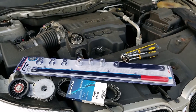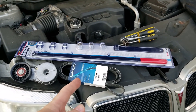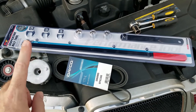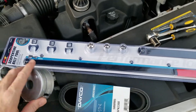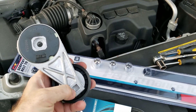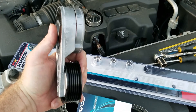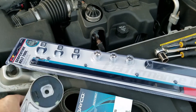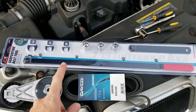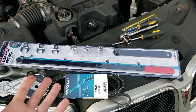So let's get at this here. The first things you're going to need are your belt tensioner and a good quality belt. On this one specifically, you're really going to want to invest in one of these specialty tools — it's going to make your life a hell of a lot easier because there's zero room to try and get the tensioner off. It sits so close to the body of the car that you can't get a regular three-eighths inch ratchet in there, so having something low profile like this will make getting it out a lot easier. If you're somebody who's wrenching on your own cars, I highly suggest investing in this — it was like $33 and it comes with all the specialty bits for any car.